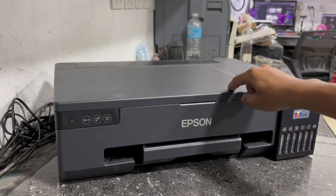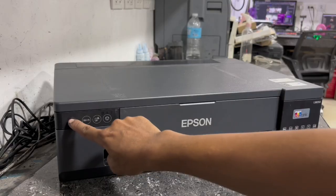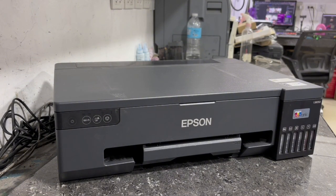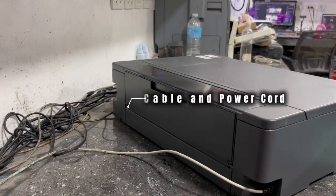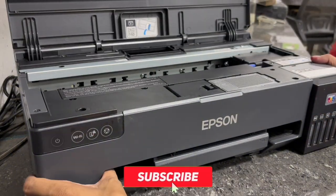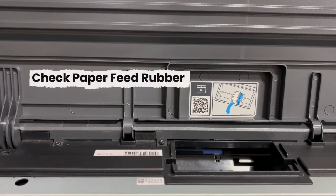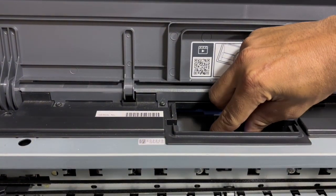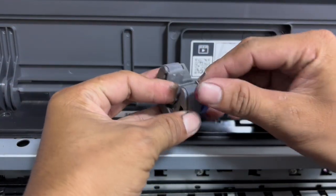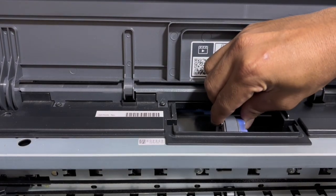Now we have to turn off the printer and start checking for jammed paper. We may also check the paper feeder rubber on its pickup arm assembly. Press the power button to turn off the printer, then wait until the panel lit indicators are completely turned off. Then unplug the USB cable and printer's power cord. Lift the printer cover to access the pickup arm paper feed rubber. Press the blue part to unlock and release the paper feeder rubber and inspect for any damage — make sure the rubber is not broken, or it will need to be replaced. In this case, the paper feed rubber is good, so we will reattach it and proceed to the next step.